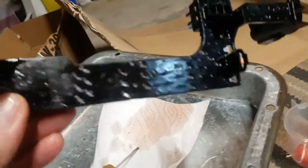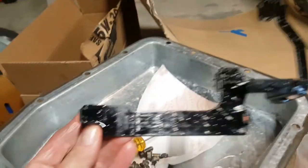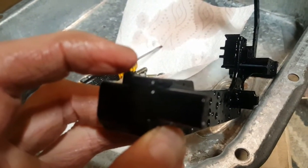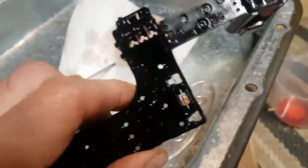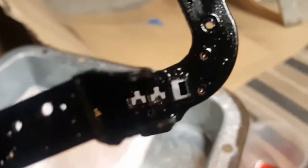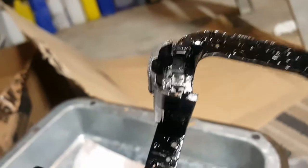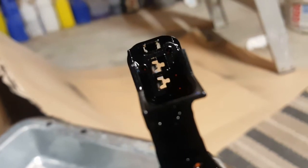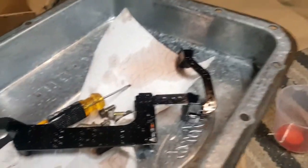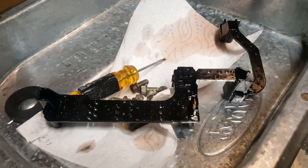On this side there's one clip right there - just a little tab that clips over; get a screwdriver, pull the tab off and this side comes up. Be careful with the ones close together. There are three holes and it's the one on the right - you can see the little tab below. The trickiest part is that you're working upside down with fluid dripping on you, and you can't get your face in there to see where the tabs are.